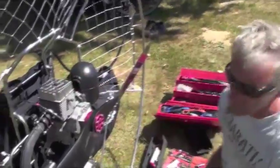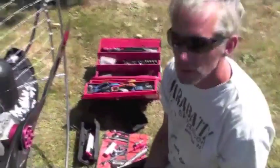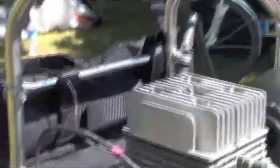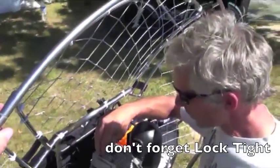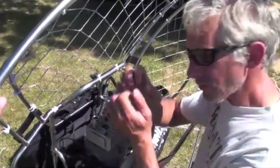We're going to clean off the residue around there to begin with. If we still get some seepage from here, we're going to have to replace the cylinder head gasket. We'll run the engine again and see if we've got anything coming up. Put the nuts on finger tight first — if you try and put them on with the tool first, there's the possibility of cross-threading.